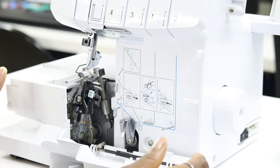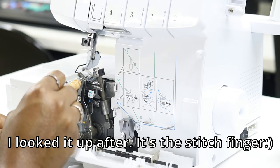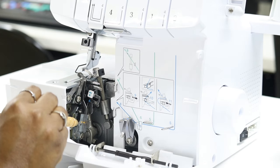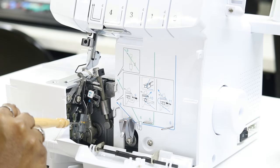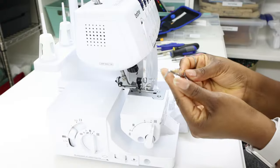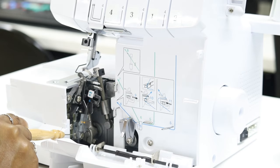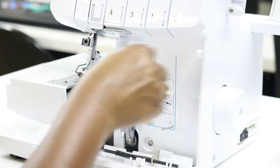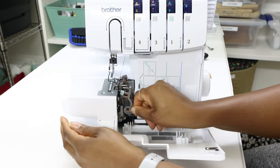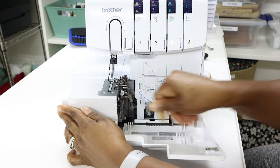With this plate, I also need to take off this piece here. I'm not sure what it's called, but it seems to be some form of guard that sits between the lower and upper loopers. To take that off, it has what looks like a tab at the bottom. On that device there's a piece that sticks off that looks like a tab as well — I'm going to press this and it's just going to pop off. The yellow arrow shows how to line it back up. You just press and it pops off. To put it back in, you line up the arrows, make sure it's sitting between the loopers, and it pops back in.